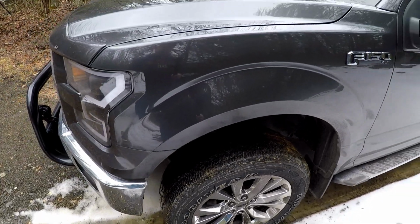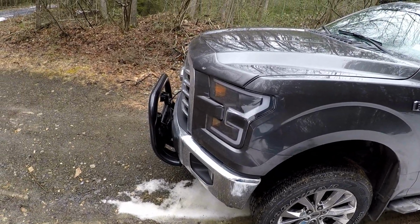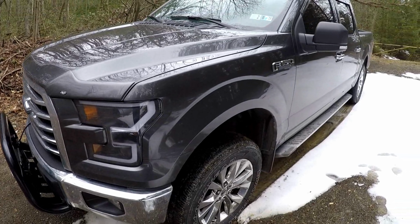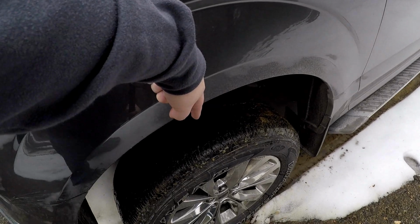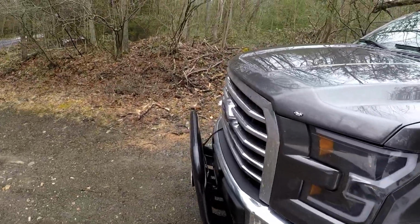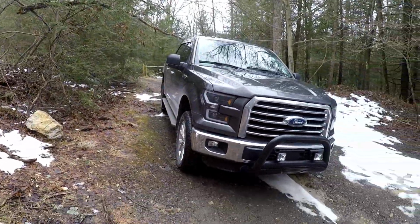And the Rancho QuickLifts are 9-position adjustable, for firmness. So you can go from really soft to really firm. The great thing is, right now as it is, I got 2.5 inches at the center line of the axle, and in the front bumper I got about 3 inches total. Now that will settle as these springs wear in, but I'm really pleased so far. It rides good, it handles good.